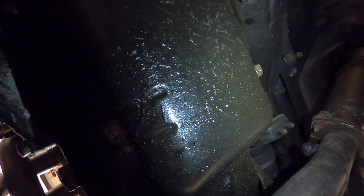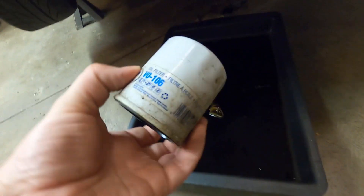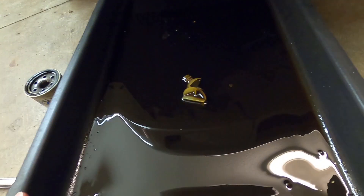It's a little oily under here. We just got to crack that drain plug and drain the oil. Looks like it's a 17. It's not giving me any trouble. It looks pretty black though, so we'll let this drain for a little bit and then take the filter out. There's the oil in the filter. I don't know if this has a date on it or anything to show me when it was last changed. I'd say that's pretty black and definitely needed a change.